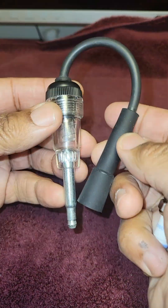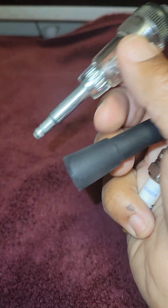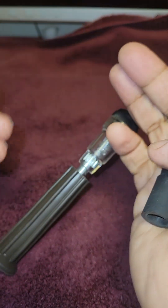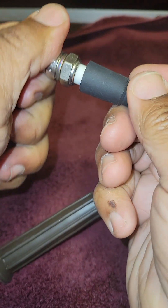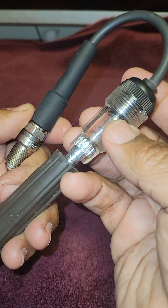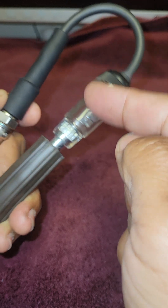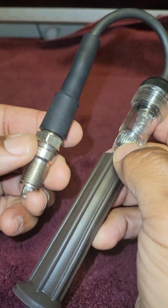Now let's jump right into it — easy, simple, and very safe to use. Take this tester and start with one spark plug wire: remove it, put the connector down into the spark plug wire, and make sure it's connected. Go back to where you removed that wire, and while the spark plug is in the motor, put this tester tube over the spark plug. Have someone crank the motor — electricity will come around and light up this area right here, and when you start the vehicle it will start blinking, meaning you have spark at that particular plug. Repeat this process for all remaining spark plugs.